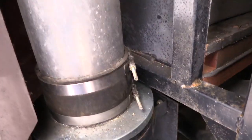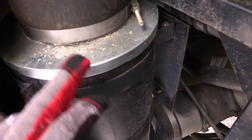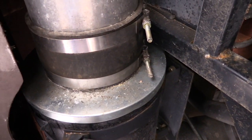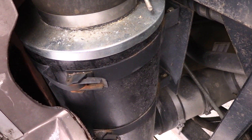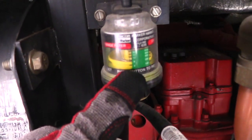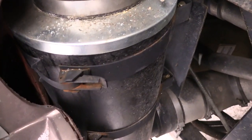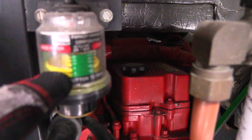Air filter is right here. See the intake side, outtake side? This is a whole can filter, so this whole thing gets thrown out. Kind of wasteful, but it lasts for, they like to say, I don't want to give you a number. But the problem with these is that you still, here's your filter reader. This shows you how much resistance is going through this. When you read this, this is what you look at to see if that's still good.